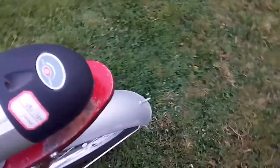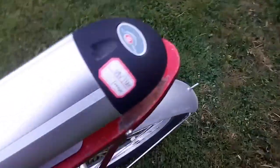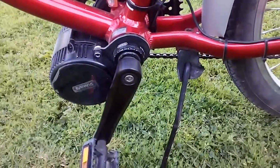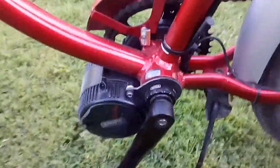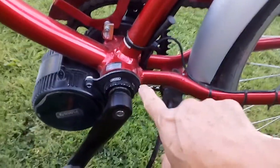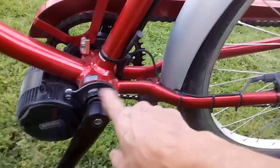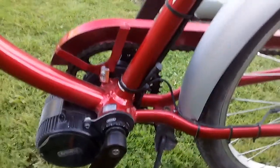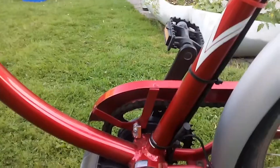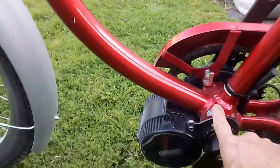Here's the battery, mid-drive. Had to make a special adapter — the bottom bracket is American so it's larger than a normal bottom bracket, so I had to put a bushing in there to reduce it to fit. Not an easy job because you can't have the holes concentric because of the space between the motor and the drive shaft.